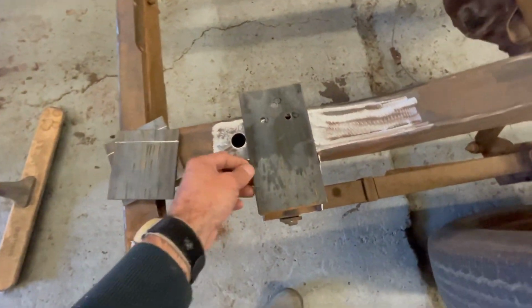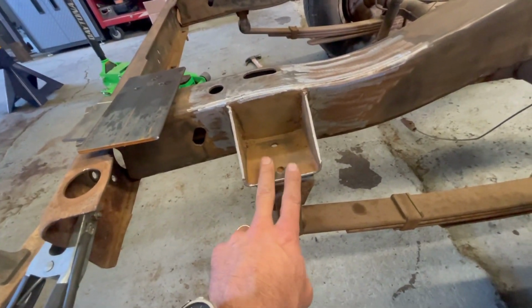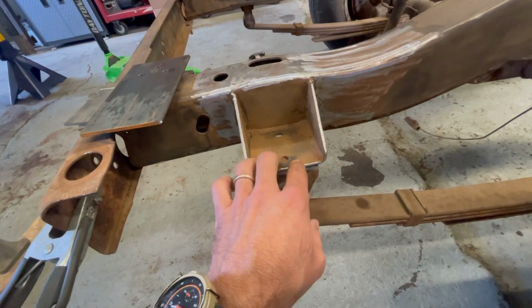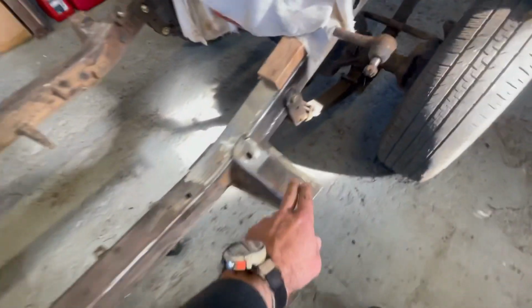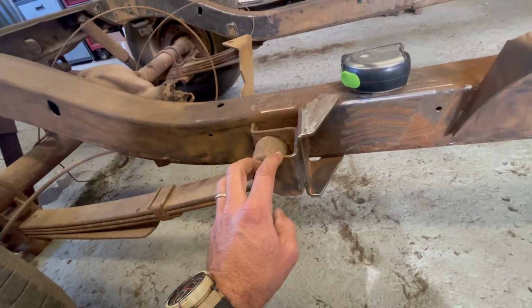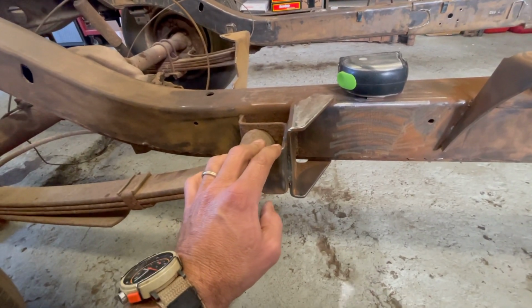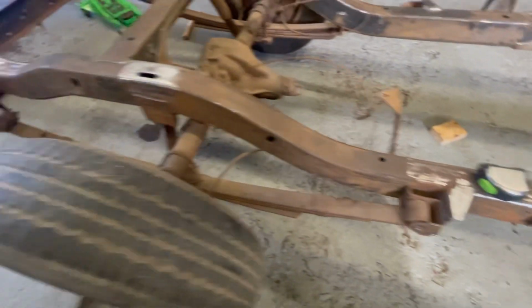I got these plates. So on the factory race truck I have, on Sherman's truck, these are all fully rebuilt from scratch in 3/16. I've not seen a lot of failures on spring hangers like this. And if you have, comment below. These hangers obviously break all the time, so those are gone and beefed up. But these, man, you just don't see these broken that often. Of the 1,000 Scouts I've seen, I can't really recount any that these have broken off, other than a really hard collision or when they've been cut off. So we're gonna gusset, close up all this stuff, and that's what I'm working on now.